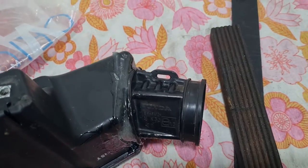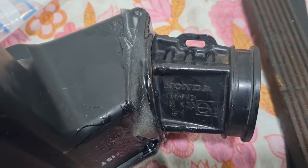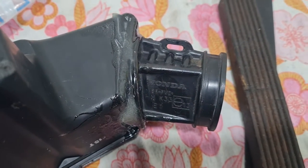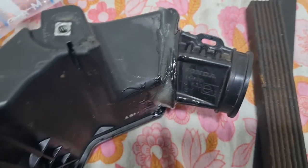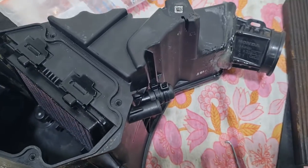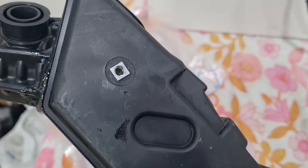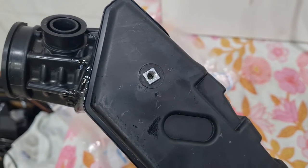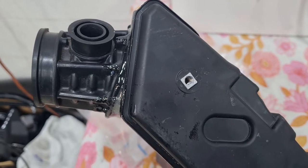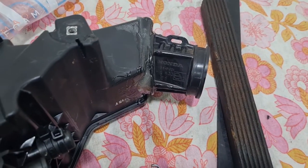I think Maverick at 550 Performance sells these. Buying this isn't just a plug and play — if you have a look, it's a freaking nightmare. You can't just sit it flush in a bigger hole. The way it lines up to the bike means you actually have to create eight millimeters of extra plastic out of epoxy to get it at the right angle for it to sit, so that the mount points line up to where they need to to reinstall the airbox. You'll actually find that this mount point here won't line up on the bike anymore because it's a few millimeters out — but that's necessary in order for it to connect properly to the throttle body. This is a serious mod for chasing two horsepower.